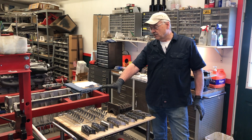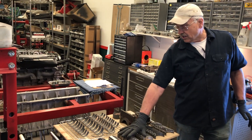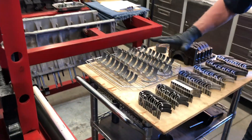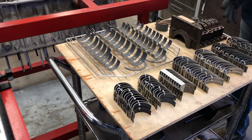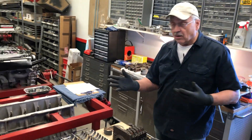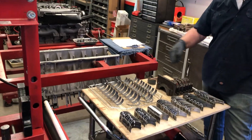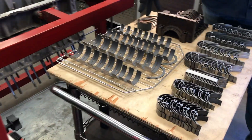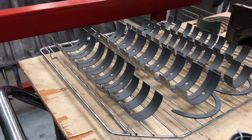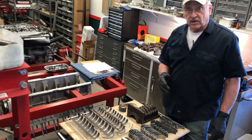A really good example is what we've got right here: a set of four main bearings and three sets of connecting rod bearings, plus another complete set of both. I had to individually measure these bearings, call them out, and figure out which ones are going to be the winners — those are them on the oven rack. I then coated these with our dry film lubricant process, and I'm every bit as confident they'll work in that engine as a brand new set of bearings.